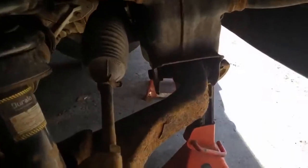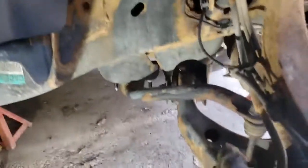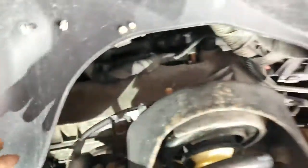I got this jacked up safely on jack stands — it's on a total of four. This should give me room to work. Got a mud flap. Phillips screws. We've got a bunch of clips holding this in. We've got to get this inner fender out — that'll clear things up. Here's a push clip. Let me check around for them. Here's another one. We can remove this. And then I've got to get in there and see what this heat shield's hooked on there with and take it out.